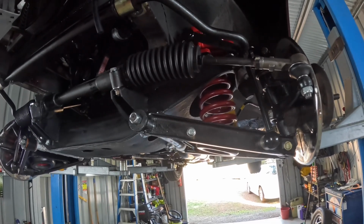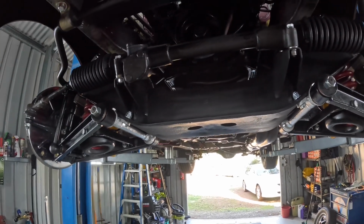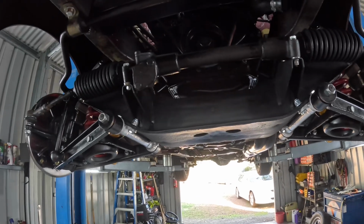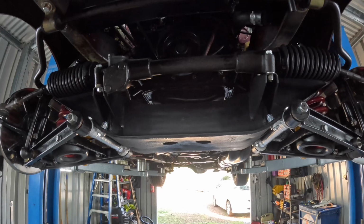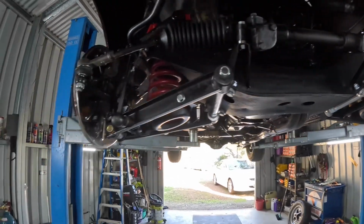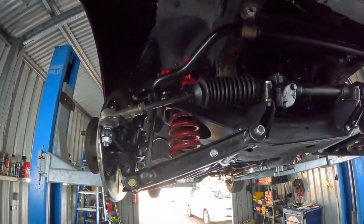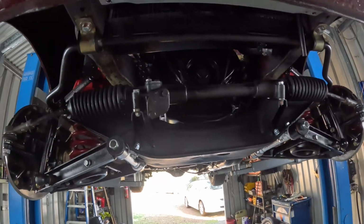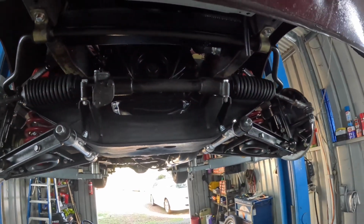to compress the springs. So when I did the first rebuild, I didn't have the engine in, and I had to tie a block of bricks around the engine mount to hold the car down with the extra weight to get enough weight to compress the springs. So that's why it was easier this time, because I had the engine and gearbox in. But without the engine and gearbox in on a hoist, there's a really good chance you'll tip the car over the back and you won't compress the springs because there's not enough weight in the front of the car.